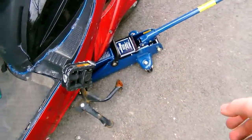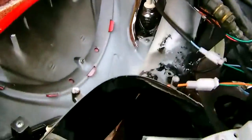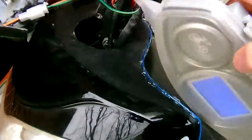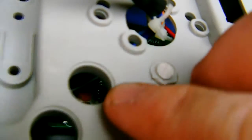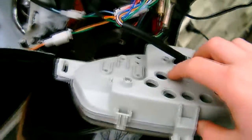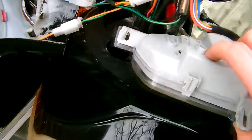So what you do is get it jacked up, or if you have a proper kickstand, just bring it up. From there, put the throttle at whatever speed it shows — in my case, 47. And then while it's at 47, there's a little dial in here. I don't know if you can see in there — a little dial right there. You put your screwdriver in there and turn it. Find out which way is up and down, and turn it just a wee bit until it starts reading what it should be reading, which is 34.